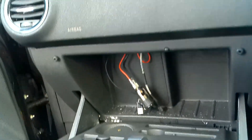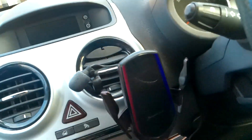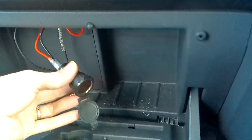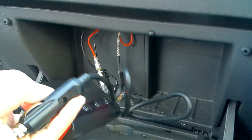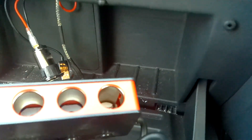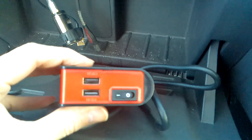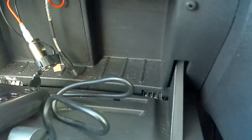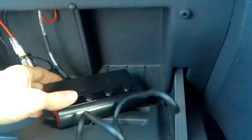At this point something went wrong with the microphone, so I'll explain. You can see I've put through the cigarette socket and also two USB leads which power a charger and also the dash cam, so I can feed those through. What I've bought is an adapter that plugs into that and gives me three additional sockets, and there are also USB chargers built into it as well. On the end there are four USB sockets and an on/off switch. You can use that in the glove box to power things up, and there are also additional sockets if you need them. There's a switch for each of the sockets so you can switch each one on and off independently.